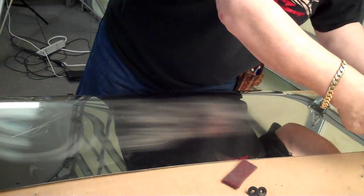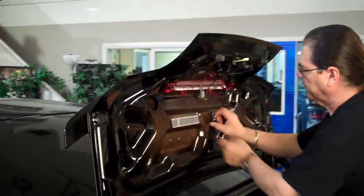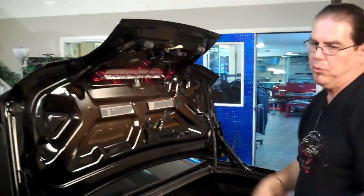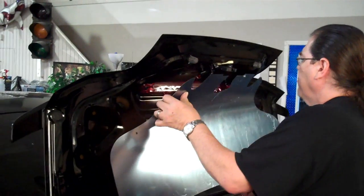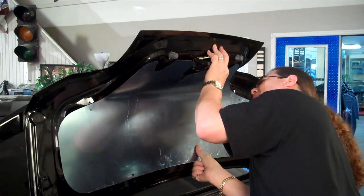Before you put your panel in, what you're going to want to do is scuff up the back here so that your Velcro strips will get a nice good bond. So you want to scuff this up. Again, use a little bit of that promoter on there. And then when you're ready, you're going to sneak up in here and pull this liner off to expose the panel, allow it to stick. We're going to put these two top bolts in first. You're going to need a 10mm nut driver or socket. You want to do a dry run before you actually put the Velcro in. Make sure that you've got a nice good alignment for everything.